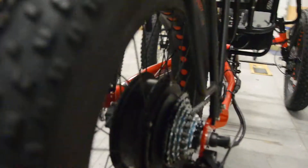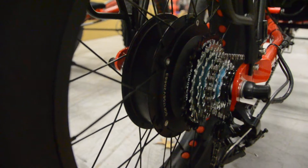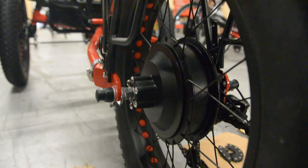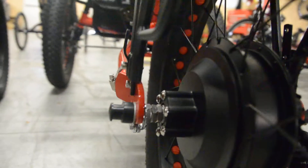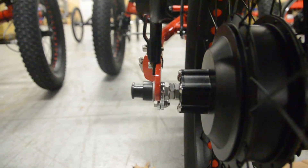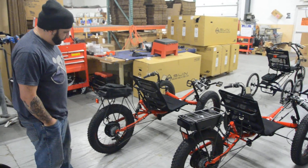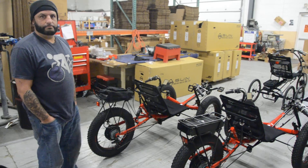You can see the motor and the rear wheel here, which is a motor we developed specifically for this bike and other 170mm or 190mm OLD fat bikes. This is an extra wide rear 500 watt geared hub motor. We've got the torque arm mounted on the inside of the chainstay in order to maximize the amount of axle we can use and keep things low profile. So there are our Sunseeker Fat Tads, all converted and ready to go to new homes. If you have any questions about this e-bike kit setup, you can let us know and we can give you some advice on how to convert them.